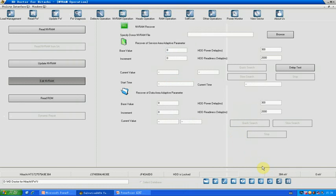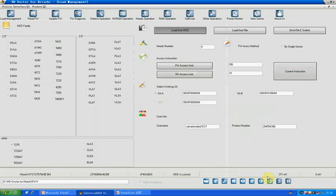Power off and go to step three: fix the PCB back to the drive, then power on. As you can see there's no SAC. The old method to unlock the password was to go to SAC first, back up the ICES module from SAC, and update the ICES backup from SAC to SA-A to clear the password. But since ARM series doesn't have SAC, we go directly to the Update Firmware tab and update the module using the modules provided in the database stored in your installation folder.